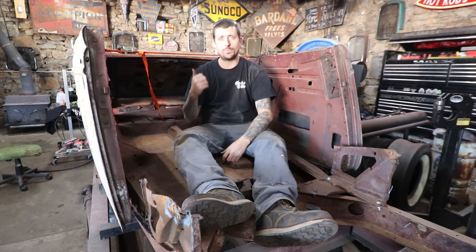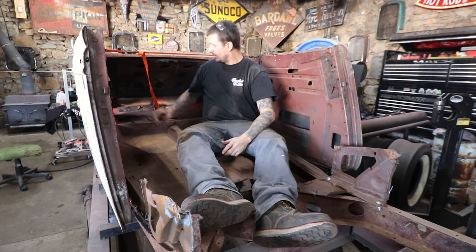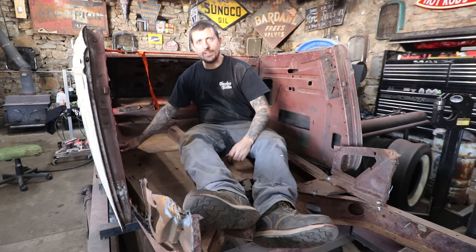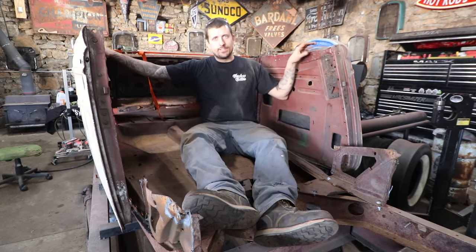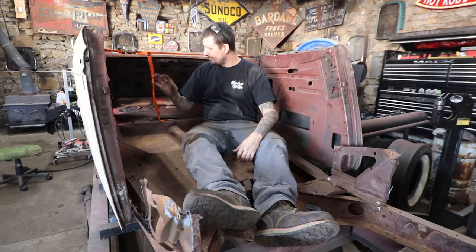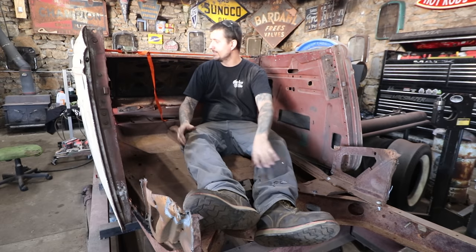That was a lot of work. So we got the rear quarters basically bolted down, quote unquote, permanently. The wheel wells have bolts that run along the floor, and we have to make some feet here for the B pillars, but for the most part, they're bolted in. There is some movement to the quarter panels. There's some bracing that is missing since this car was in pieces.